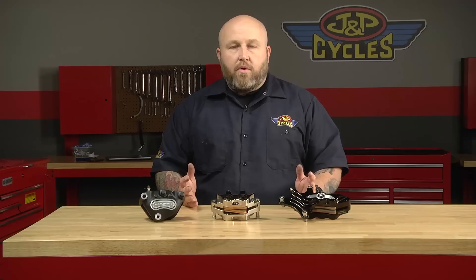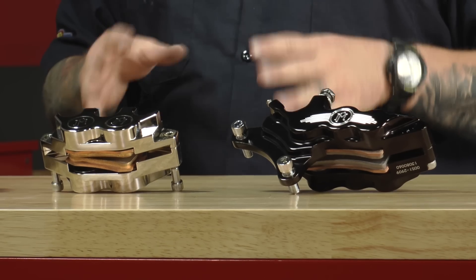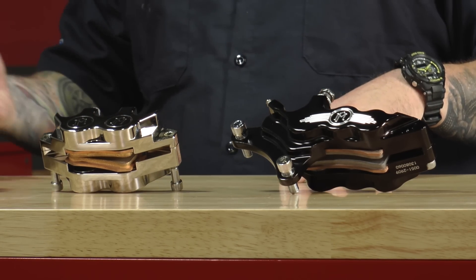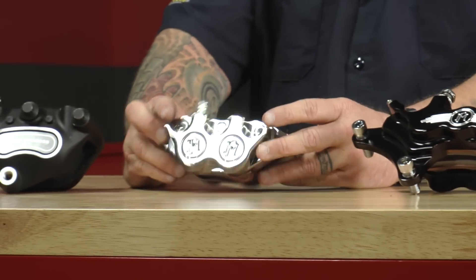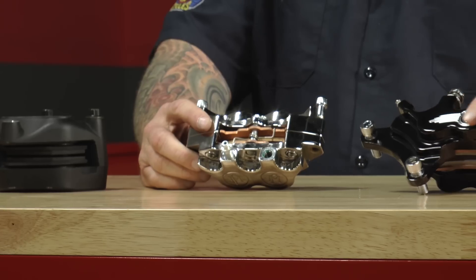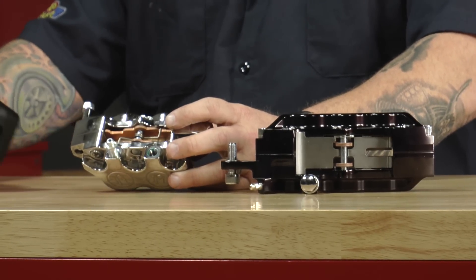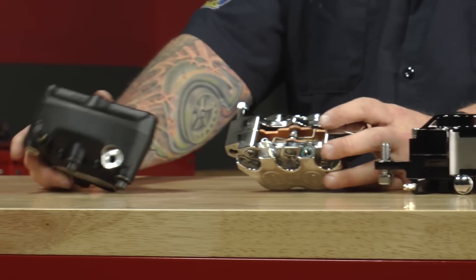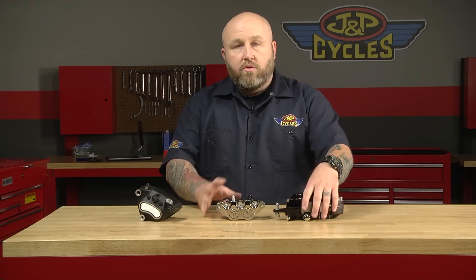Why would you buy expensive calipers other than aesthetics? Well, they're going to brake better — and why do they brake better? A multitude of reasons. Basically, any time you can get rid of heat in any kind of braking situation, it's going to result in better braking. To the naked eye, right away, you can see the quality and craftsmanship in the caliper itself compared to the stock blob here. The caliper is going to dissipate heat better just because of their design. If you look at the backs of these calipers, they're a lot more open on the back — there's no material that doesn't need to be there, as opposed to this one here where this thing is going to dissipate heat about like a landscaping brick. So this one is going to give you a lot better heat dissipation just through design itself.